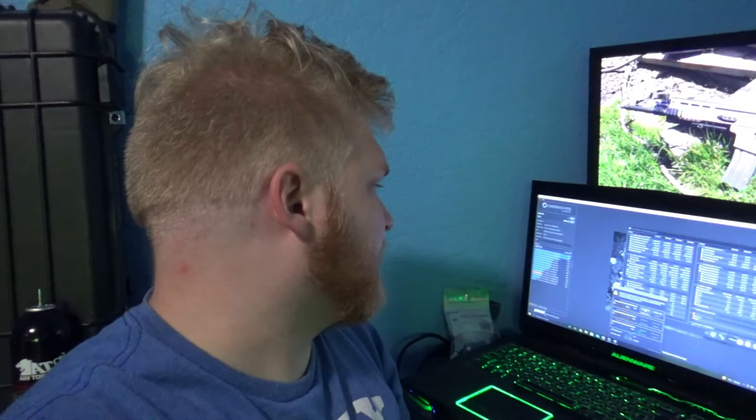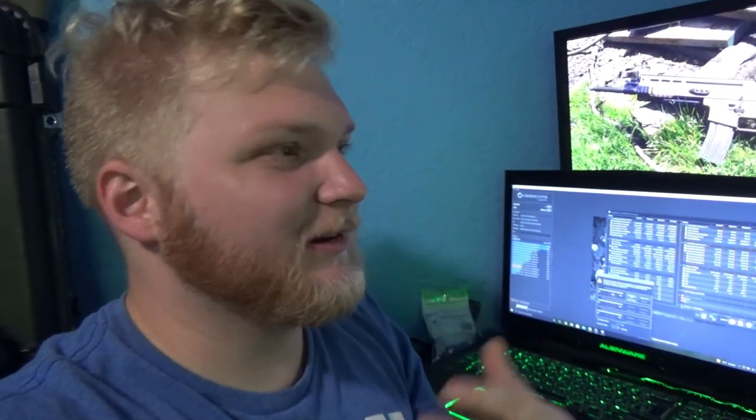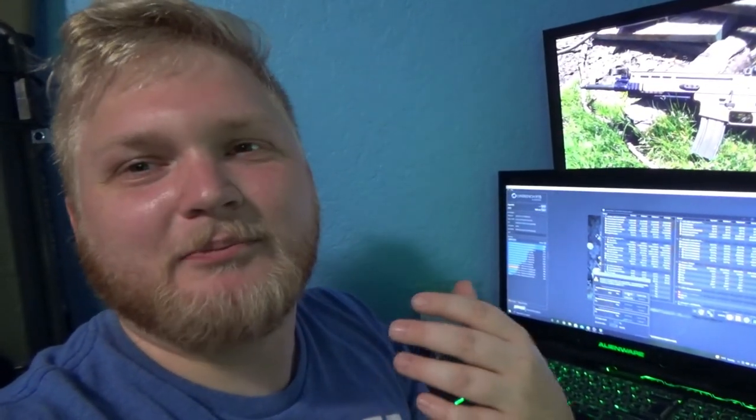But yeah, that's kind of it for today. It improved Cinebench a little bit, improved temperatures a lot. I suspect the reason my idle temperatures are higher is due to the thermal paste, so I ended up using TG7, not that there's a logo on my tube, but this is TG7 from Thermaltake, which is my normal go-to if I'm building someone a computer because it's cheap. It's really good. I tested it a few years ago. I was going to do a video on it, never published it, but it's basically better than anything else I could get at Best Buy locally.